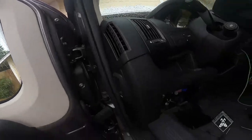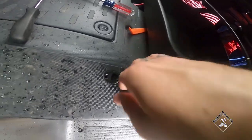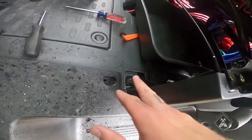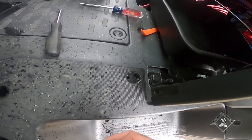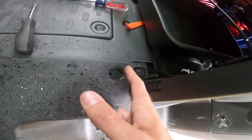The wire is ran along the top — you can see it barely sticking out there. I'll tuck that in down the weather stripping and around to the mirror location. Because I have the 159 extended wheelbase, I had to buy an extension kit for the wiring that comes with the mirror. It's actually the perfect length to run through the dash, and then from there back will be the wiring that came with the kit. I'll leave a link in the description — it's a 12-foot extension.